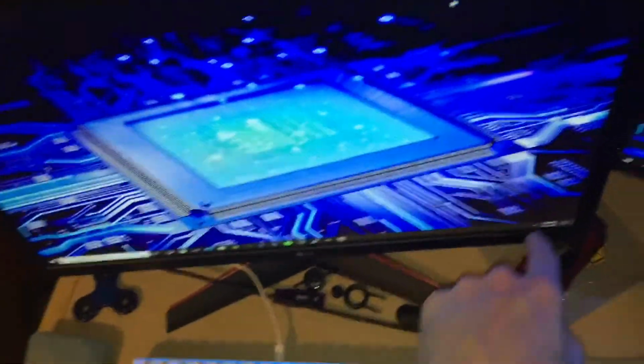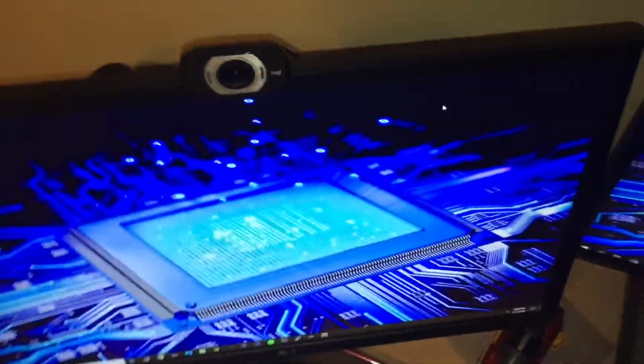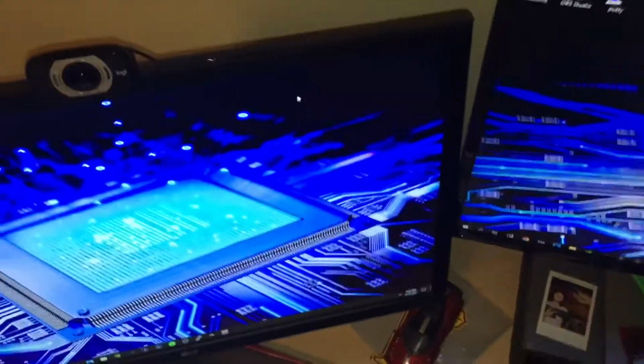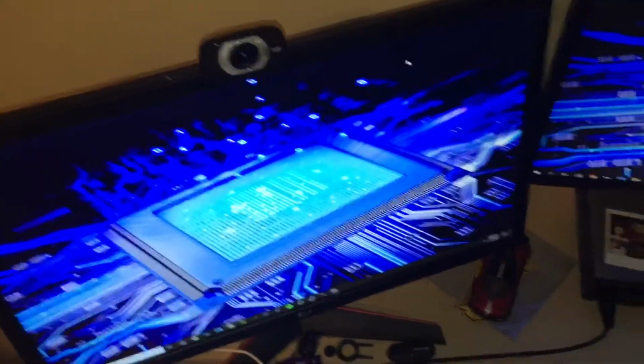You'll just have an Activate Windows watermark that can get kind of annoying. So yeah, there's plenty of programs like that, Produkey, stuff like that. Because at the end of the day, HP installs operating systems on a bunch of computers all at once in the factory. And so sometimes you're not going to get the actual individual license key that was specific to your hardware. You're just going to find the one that was like the batch.